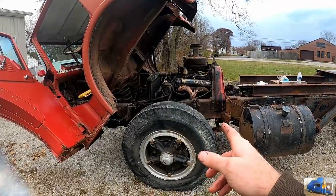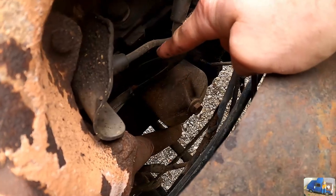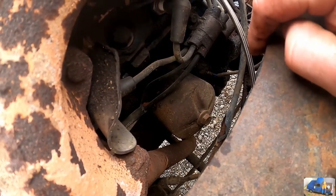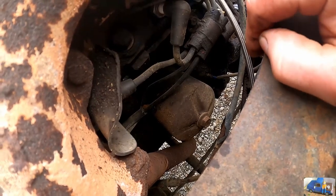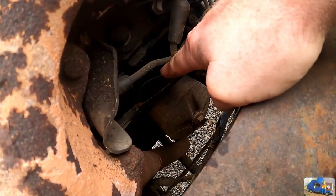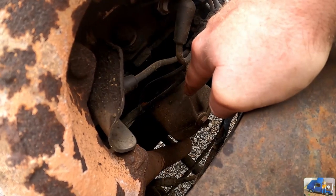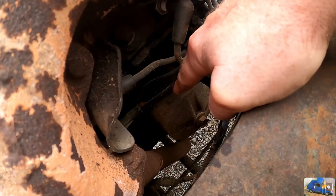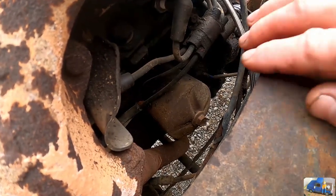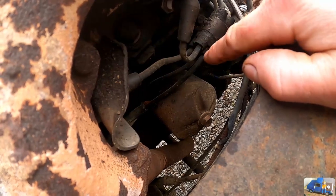Got the oil dumped, put new oil in, but I didn't change the oil filter, largely because I don't know, can you see that? That's the oil filter housing, and I believe that's a cartridge type oil filter. Now I went to my local Napa the other day to try to get verification on the correct element, and they were doing a Google search, so I wasn't very confident. What I found Google searching was a C750E Baldwin filter, but this looks like it's a whole lot smaller. That almost looks like a PH8A housing if you were to compare it to a spin-on. But if you know the correct oil filter cartridge for this, let me know, because I have no idea.